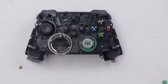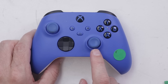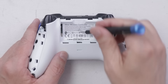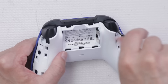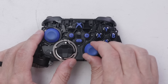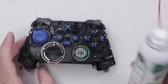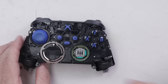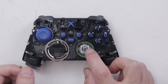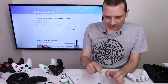Number six and seven also had no problems found so far. For number eight, this right stick is drifting, so I'm going to get it apart — I'll try cleaning it first, and if that fixes it we'll call it good; if not, we'll repair the analog stick. This one has been taken apart before. This is the analog stick causing the problem. I'm going to use this BW-100 electronic contact cleaner — it's pressurized and with the straw I can get right down into where it needs to go to clean these analog stick potentiometers. With it clean, let's plug it in and see if that fixed it — and that definitely didn't fix it, so we're going to need to replace the potentiometer.